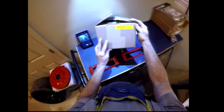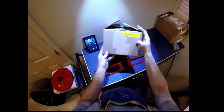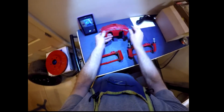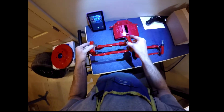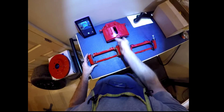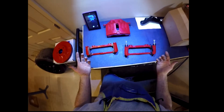I have some part numbers on the caliper itself. I liked that it was already powder coated — the part number is ADO 172 2421, and that's the left-hand side. The right-hand side is ADO 172 2422 — the only difference is the last digit: two is for the right hand and one is for the left. It's kind of nice that you can still buy it brand new. I've seen this caliper for the C4 in black, but I wanted red. I found one on Amazon for about 90 bucks and the other one for 180 bucks at Summit.